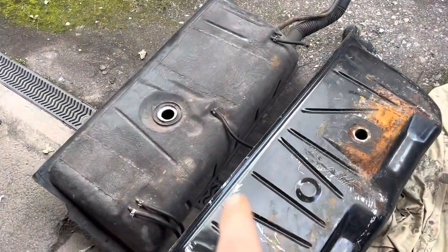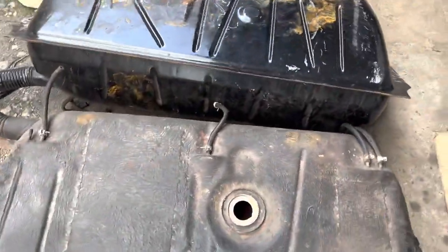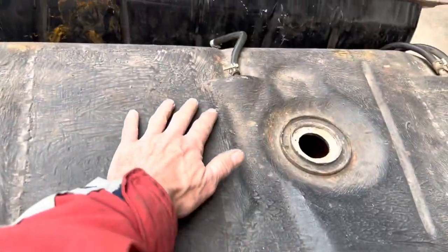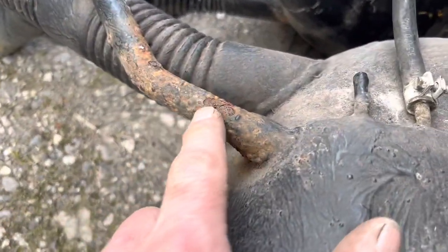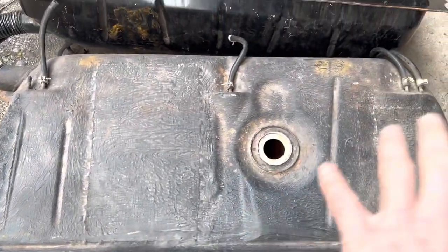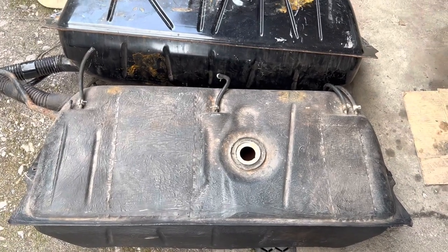The other alternative to using that new fuel tank is to use the fuel tank that actually came with the car when we bought it. The problem with that is you can see that this fuel tank has been patched several times — there's a patch there, there's another patch here, and also the pipe here is rusted out. All of that can be repaired but the tank would have to be cut open and re-lined, and that is similar in cost to getting a new tank.